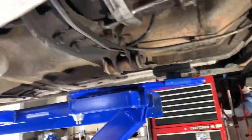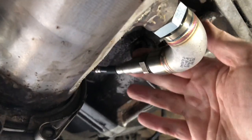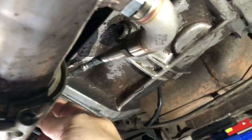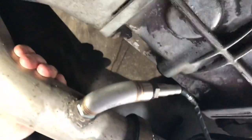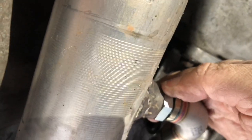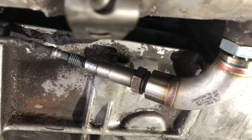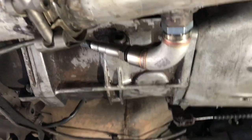I just test-fit this and it fits pretty well. It's a little close to the transmission, so the best tip upward I can get is about right there — I don't want the wire hitting the transmission if it gets hot. But it is tipping up, which is the effect I'm looking for, so I think we're going to be okay. What's cool about this is you can position it where you want and then tighten this piece independently of where you mount it. Overall, I'm happy with the way this is going to mount. Now we're going to do the rewiring to extend the O2 sensor wires.